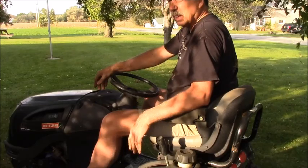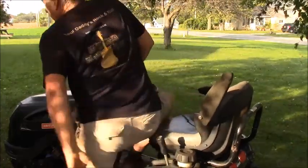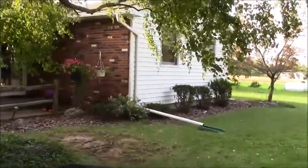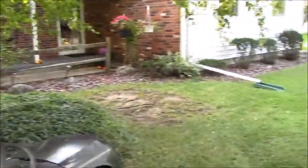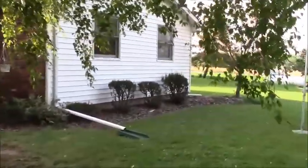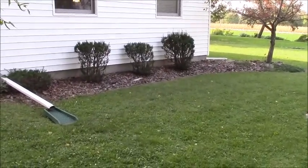That's a big project. Oh, I need to finish hooking up that electric water heater in my basement. Unfortunately, my electric panel is next to the window there in the garage. My bathroom is around the corner from that end of the house. So I've got to run a wire from the panel into the rafters, over, and I'm going to come down the inside of the garage wall in some plastic PVC. And then there's a drop ceiling in the whole basement, and I'll run the whole length of the basement. And I'm going to put an instantaneous Titan water heater up in the rafters right below the bathroom. So now when you hit the bathroom faucet, the water will be hot almost instantly.